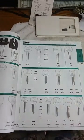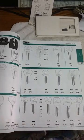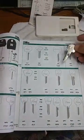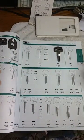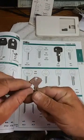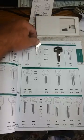And as far as the Ferraris are concerned, I had a Ferrari 328, and when you're talking about the keys, you look at the blanks. Here it is. There's an FT46. That would be the ignition key for a Ferrari 308, 328. The Mondials. Here's a F91CR. So that key would be right there. There's the blank for that.